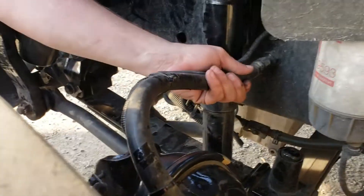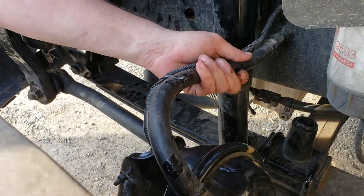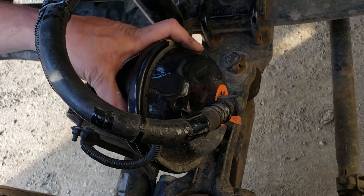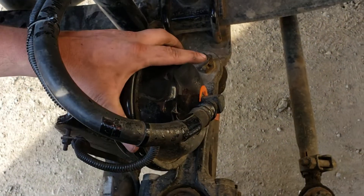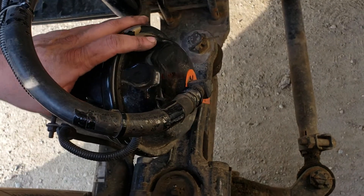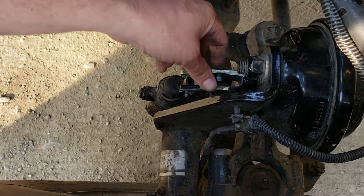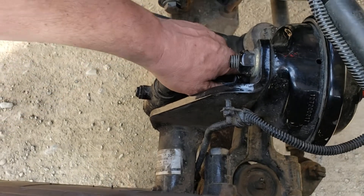My brake line is secure at both ends with no abrasions, bulges, cuts or damage, and is not leaking. My brake chamber is properly mounted with no missing hardware, not dented, damaged or missing, and not leaking. The brake chamber clamp is securely mounted, not bent, broken or missing, and not missing any hardware. My push rod and slack adjuster are properly mounted, not bent, broken or damaged, and are held together with clevis pins and cotter keys. My push rod should have no more than one inch of play when pulled while the brakes are off.